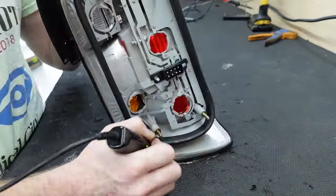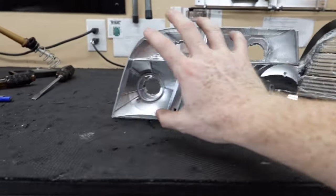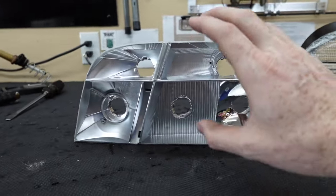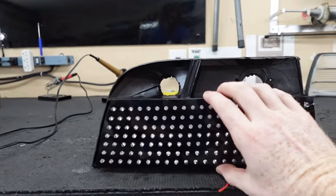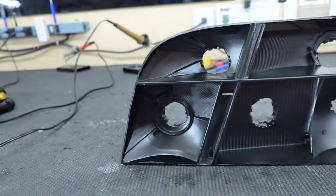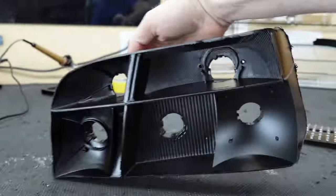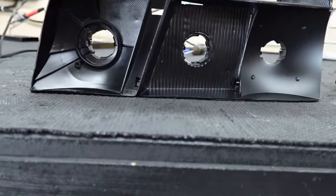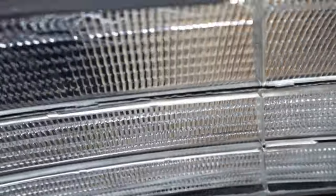These are plastic welded, so they have to be cut open to install the boards. The taillight lens is now officially cut off the back housing. We're going to paint this whole inner section black, because the chrome would be visible around the boards and would look really weird — little slivers of chrome next to the black boards. Now we have a full solid black housing. Next I'm going to try to fit the boards in place without cutting the back tabs, because a big gap in the back would look ugly. The lens has pretty deep lines running through it, so we'll see if there's enough clearance.